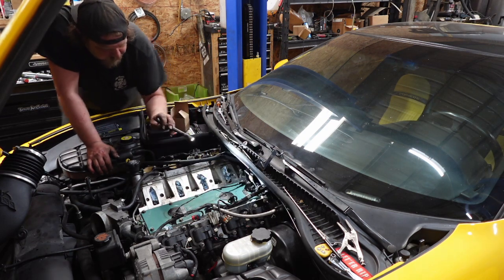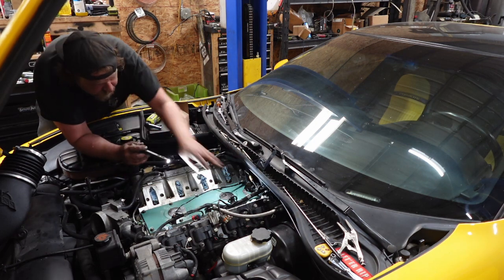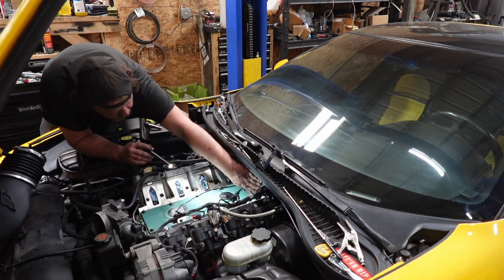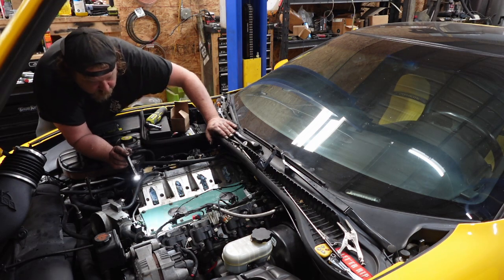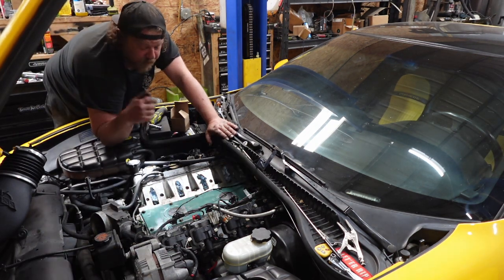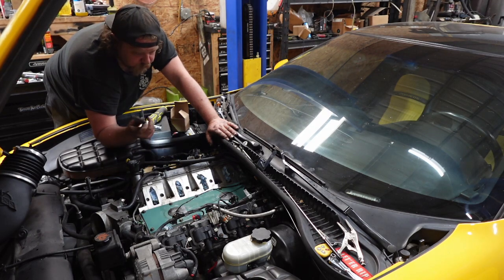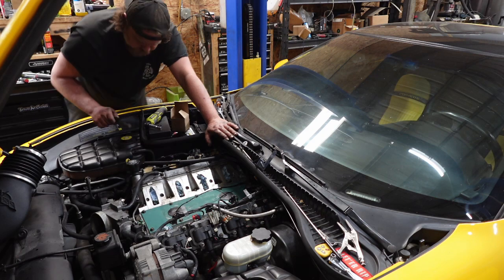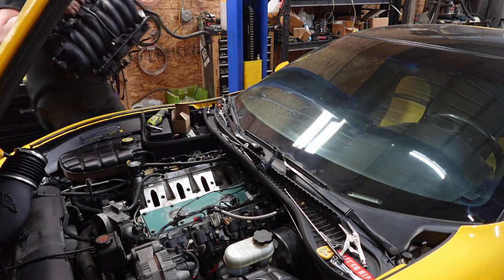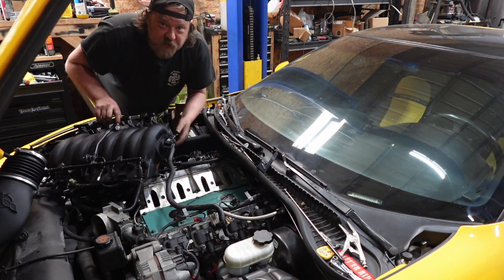All right, those are good, those are clean. No coolant or anything looks like it's leaking, so we're good there. I guess we could drop this manifold back on. Already cleaned all this stuff up. I gotta change the gaskets in the manifold. They're easy to just pop out and you put new donuts in there. But let me do that and I'll be right back to shove this thing together. All right, I gotta change this battery. I'll be back.